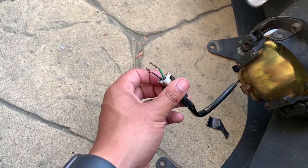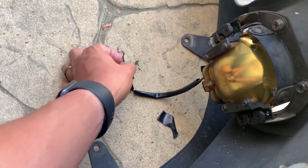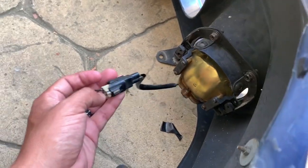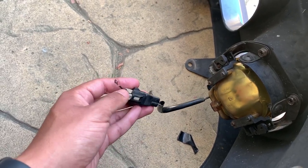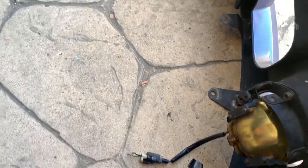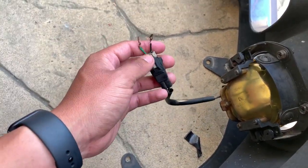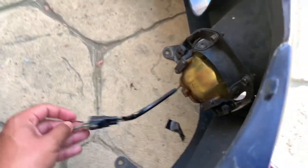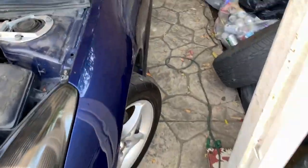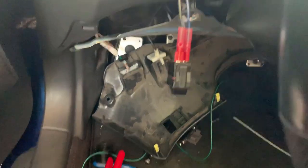The fog light plugs are not the same as OEM, so you would have to tap into the OEM fog light wires - positive with positive, negative with negative. The black one is negative and the green one is positive. Since he wants independent control, I need to get power from a direct source so he can turn them on whenever he wants, not just when the headlights are on. I'm going to get a direct power source, ground it somewhere, and run it to the switch. The blue is my power - I ran it all the way inside for the switch, and it's already wired up.